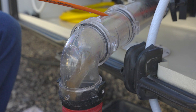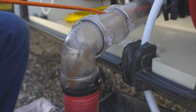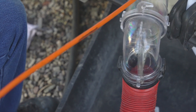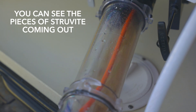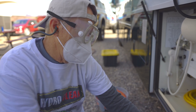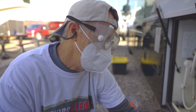Does this look normal to you? Usually worse. Really? Now you can see the sheets of struvite coming out. This is my guide, and I know that the nozzle is pulling toward those lines. I can get to the back and turn it to reach the back wall and then work my way back. Generally I try to pass through the tank three or four times — at least four times — just to make sure I get 100% coverage on the clean. There's a lot of surface to work with in there.